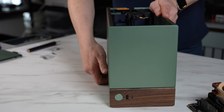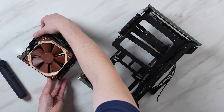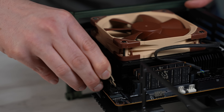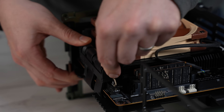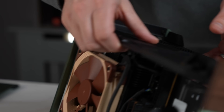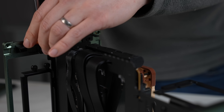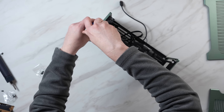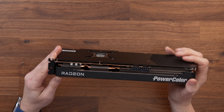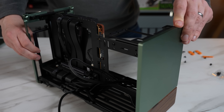I need to remove the top panel and then both of the side panels. This gives us plenty of access to install all of the components into the Terra easily. We drop in the motherboard and insert the four screws to secure it into place. We then plug in the Gen4 PCIe riser cable supplied with the Terra, and also put in the power switch and the USB 3 header. With regards to the spine, although you could use the default position, it would have put the CPU cooler right up against the side panel and that can cause turbulence — a noise I really don't like on my PC cases. I always like to give it at least a 5mm gap or more if possible. We're going to be using a slim graphics card today, so I can move the spine to position 3, giving us a nice gap on both sides and allowing for whisper quiet gaming.